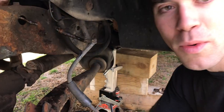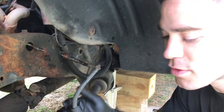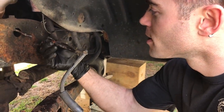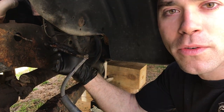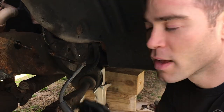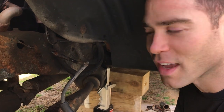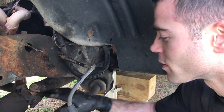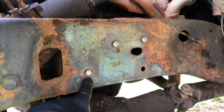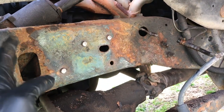Here's a little secret: when you split a brake line, take the female end — you're usually close to your caliper which has a bleeder nipple with a cap on it. Just take that cap off your caliper and shove it right in the open brake line, and it'll keep the rest of your brake fluid from leaking out — saving you from having to buy anything extra to get your truck back up and running.